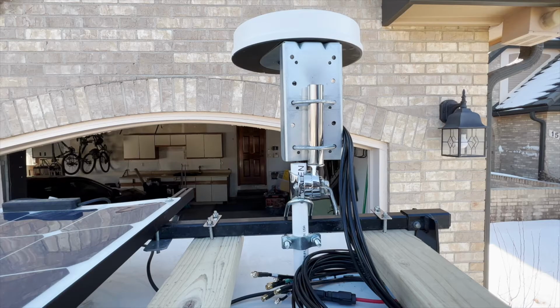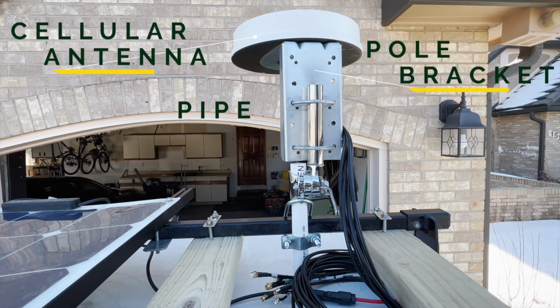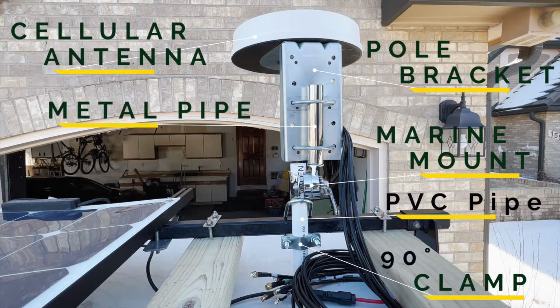The trick with this setup is finding the right parts and making them come together the right way. For my installation, I'm going to attach the cellular antenna to a pole bracket, which is attached to a metal pipe that threads onto a marine mount. The marine mount is bolted to a piece of PVC pipe that is itself bolted to the roof rack of my hiker trailer with a special 90-degree clamp.